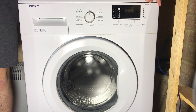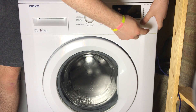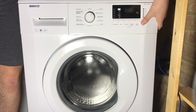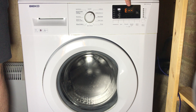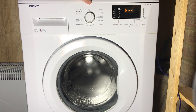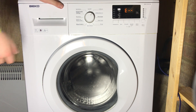There are two ways of doing this. The first method, which is probably the most obvious, is to go into service mode by pressing and holding start while turning the knob one to the left, right to the other, and then release when you get E dash dash. If you have any stored error codes, this will say E01, E02, E17 for example — up to 18 these go: 1 to 10 and then 17 and 18. If yours just says E dash dash, you don't have anything to worry about.